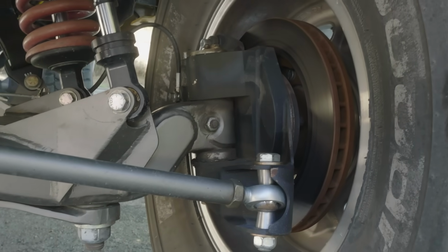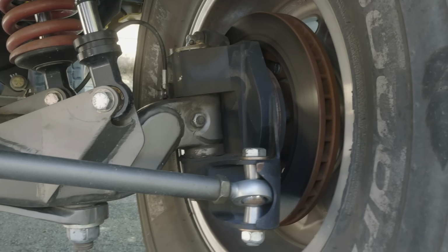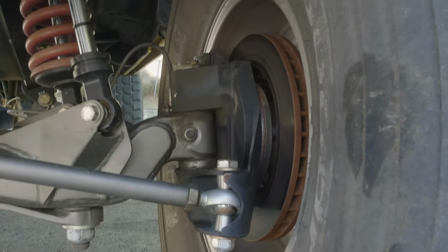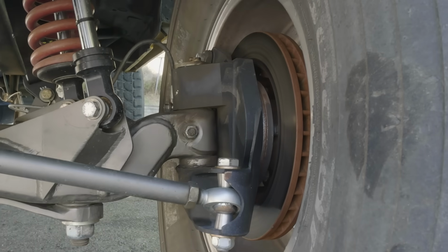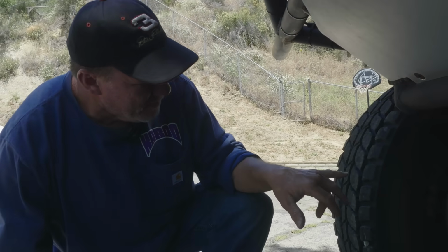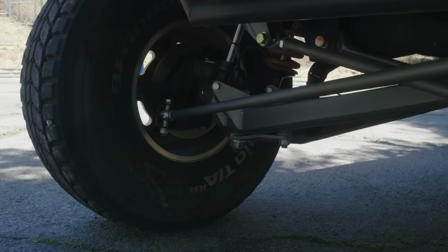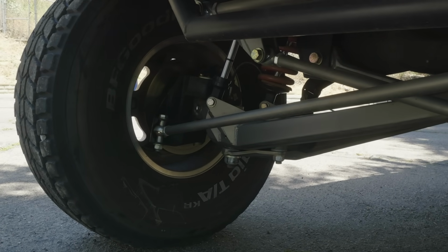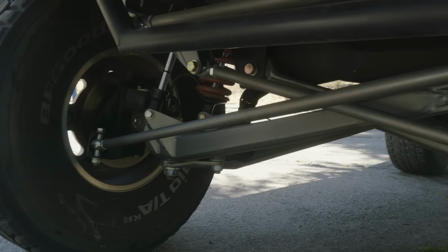Danny said, hey, this might be a concerning area, because even the 1-ton spindle's got a little tiny wheel bearing. So that takes a Dana 60 four-wheel drive snout. And that way, too, you can buy all the parts if you break something. It's not some order-it-online custom snout. You can bolt that off and buy something. The kingpins you can buy at the auto parts store. It's got Chevy calipers and 1-ton Chevy rotors. So wheel bearings, all that stuff you can get at O'Reilly's. I love that, man.